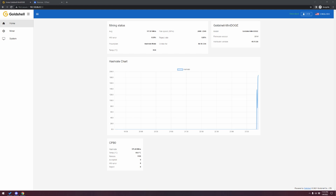We've been up and running for five minutes since we made those changes, and we're at 177 megahash currently — that'll continue to climb. You can see temps in the bottom left, as well as important things like rejected shares. Internet connectivity is important — you want a good solid connection or you'll start to see a lot of rejected shares. If the miner is in a really hot place, you'll also see that effect on your rejected shares, so keep that in mind.